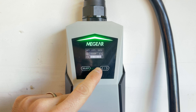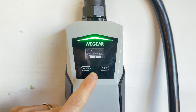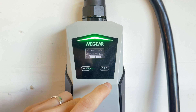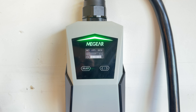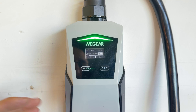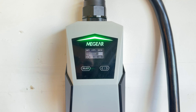The other selection is a delay for when it starts charging. This is super helpful when you have cheaper electricity rates at night. So when you get home at, say, six o'clock, you can set it to start charging six hours later at midnight, hit select, and that's it. You just plug your car in and six hours later it will start getting some juice.